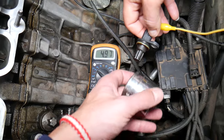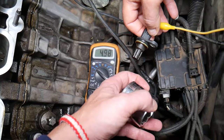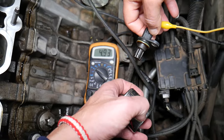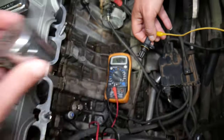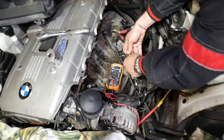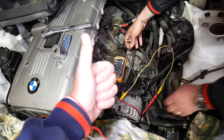Most of the time it works correctly, but the key test is: when you apply metal to the sensor it should go to zero volts, and when you remove it, back to 5 volts. That's how it works. Hopefully this video will be helpful to any of you trying to figure this out. Thank you for watching, please subscribe to the channel for more help, and see you guys next time.